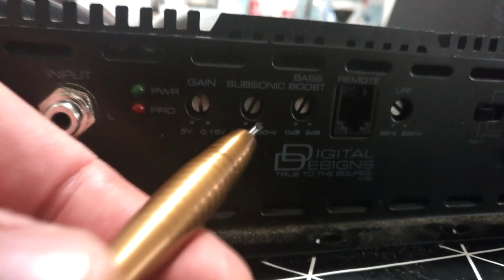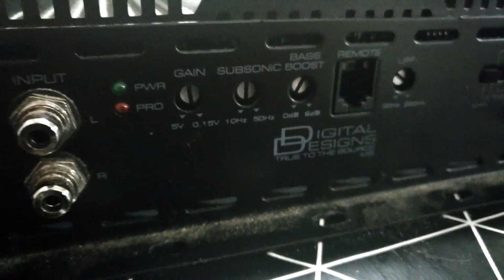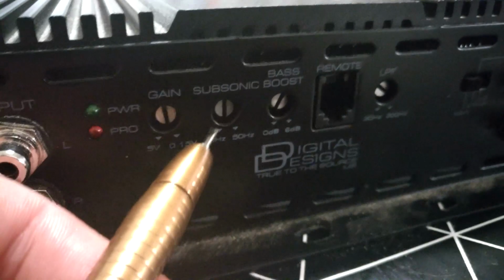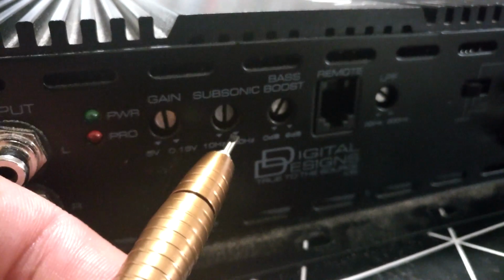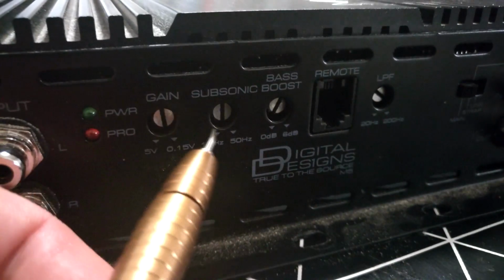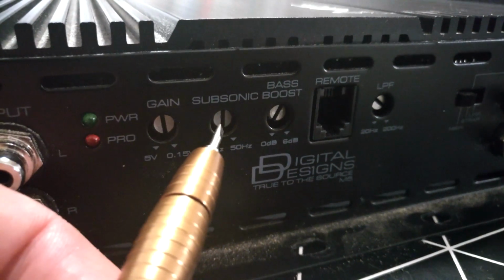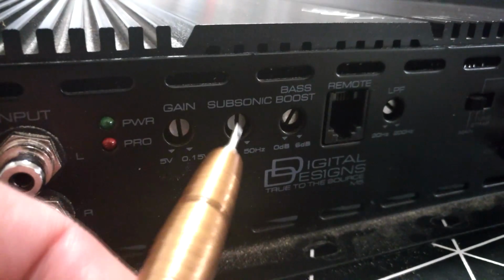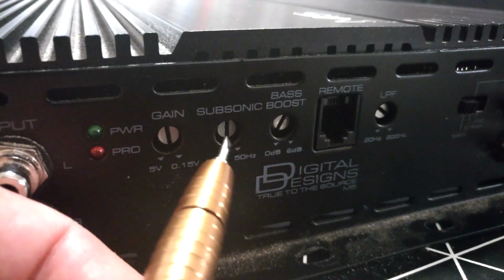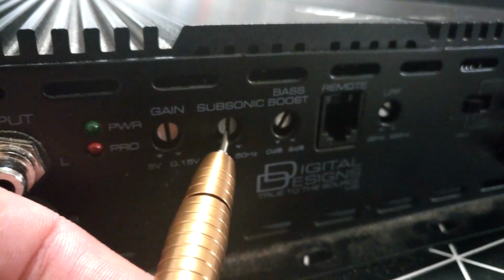We put this in the middle here, upward position, and then we calculate that 50 Hertz minus 10 Hertz is 40 Hertz. So here to here is a 40 Hertz rise. Now 40 Hertz divided by 2, because this is on center, is 20 Hertz. So 20 Hertz plus the base value 10 Hertz equals 30 Hertz. So this in upward position is at 30 Hertz.